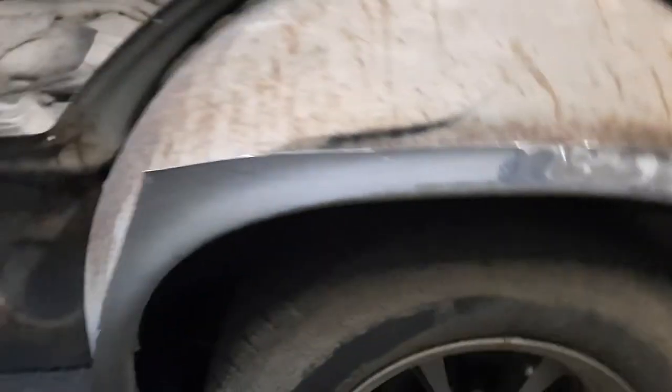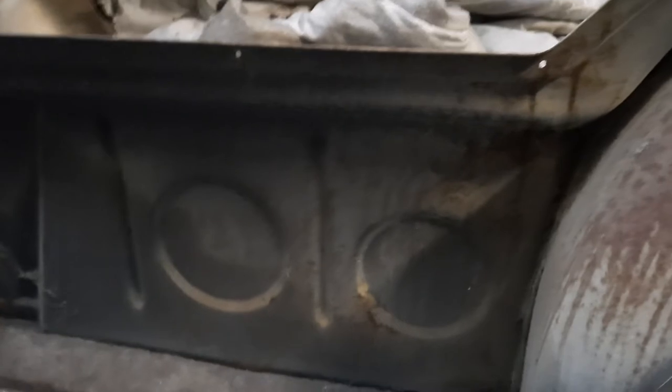The point I was about to make is I may well be able to get to it. I don't know where the chassis actually runs — whether it runs up high or down low — but I'd say it runs down low because it's going to go under the floor. So there's a possibility I can cut this panel out and do these plug welds whilst the chassis is in place. If the chassis itself is in need of paint, I'll eventually take it off and do it separately, but I might not actually have to take the chassis off to do this quarter panel.